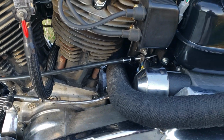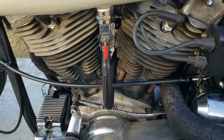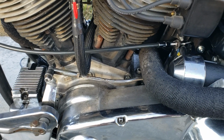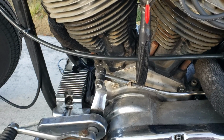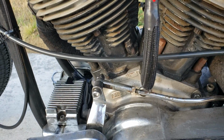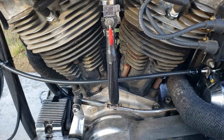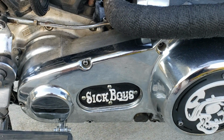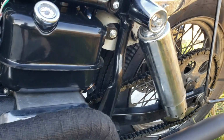It's running a, I always mix them up, Super G, I believe, the larger of the S&S Super carbs for the big bore motor. Jetted correctly, and it's located here in Fort Collins, Colorado, so we're at like 5,000 feet. It's jetted perfectly for here. And you can see the S&S logos. And I verified the flywheels with S&S, so it is a full 93-inch motor. The flywheels, at least, were sold in 1996, for whatever that's worth.